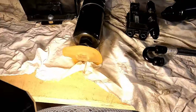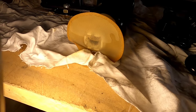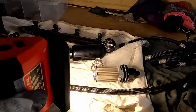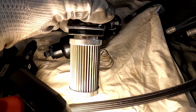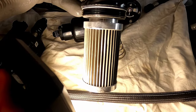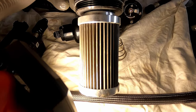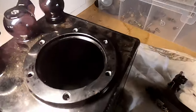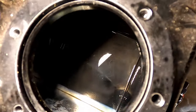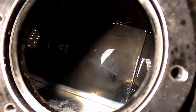If we look over at the filter sock on the tank — the pump from the surge tank — that's a lot more crappy. It used to be white and is now stained, and you can see there's a whole bunch of crap around the pickup. Moving on to the fuel filter itself, it's pretty well clogged up with a thin film of contamination pretty much all the way around it, which was as expected. And if we look in the surge tank, there's a lot of milkiness and residue on the wall — quite a lot of dirt and crap inside that.